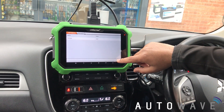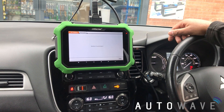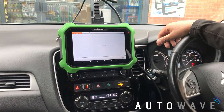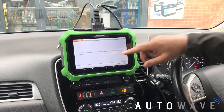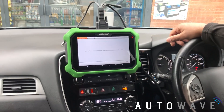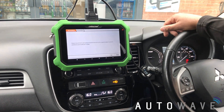The PIN code value is 030F. I'm going to escape and remember that. I'll also now hit Key Count — it tells me the number of current keys is two. The customer only has one, so at least I know we've established communication with the vehicle. I've left my ignition on, and now I'm going to go to Program Keys. It tells me again I need to be connected to the internet, so I hit Enter. It needs at least one programmed key, which we have, so I hit Enter.